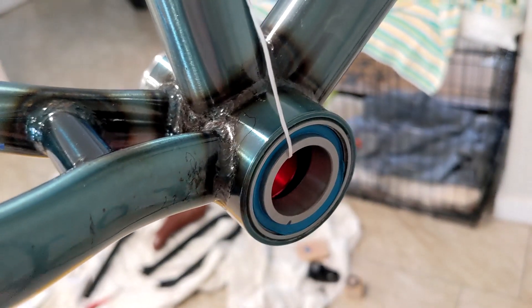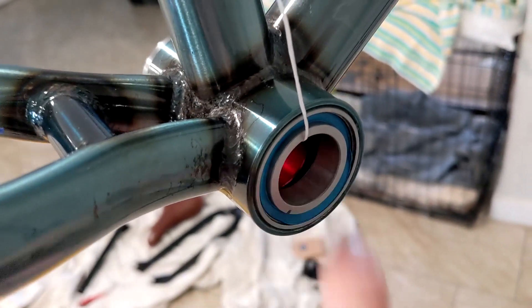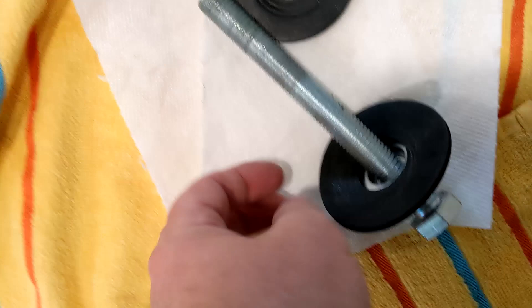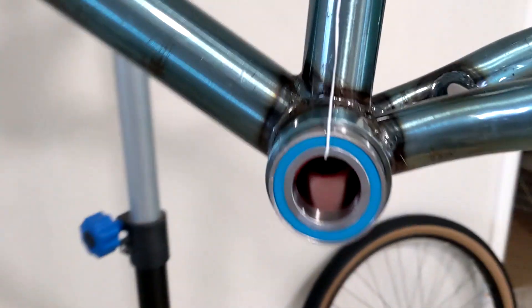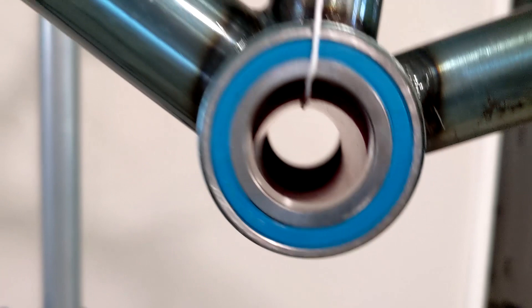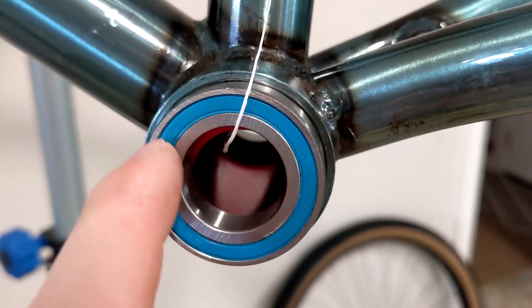If I had another bearing I'd swap this out, but I want to ride this bike today so I'll fix it later — probably never if there are no problems. My point is I wouldn't use rubber pieces if they're too flimsy; this one was pretty flimsy and must have pressed super hard and pushed that bearing cover in. The second thing: I'm about to press in the second side, and you can see the spacer in there. The spacer presses up against the inside of the bearing, and if it's off-center it can push against the cover and mess it up just like the other side.